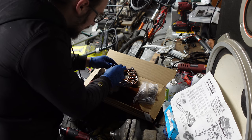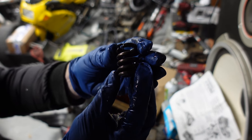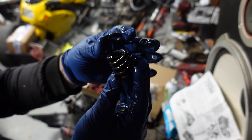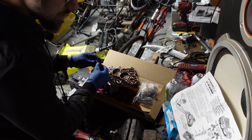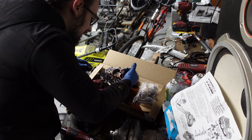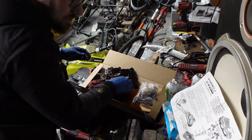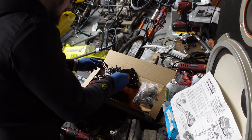I didn't expect to find this — the stock accumulator spring is broken. I'm not sure how much that would be affecting performance, but it probably does affect the spring rate to some extent. Maybe that's why this thing shifted like absolute crap before we tuned it. Please tell me I don't have to reuse any of these springs. Look at all the gunk in there. The gasket is reusable by the way — it's metal. Okay, these are the springs we're replacing.